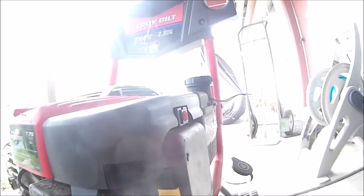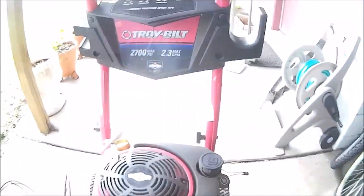Alrighty then, so we got the bowl off, cleaned it, put it back on. By the way, this nut on the bottom is 1/2 inch. And you do not need to crank this down. Just when you put it back on, just barely snug it up. I just use the ratchet and just use 2 or 3 fingers and just snug it up. No need to crank on it because you will wreck this gasket and this bowl. So here we go. Get some gas in there.